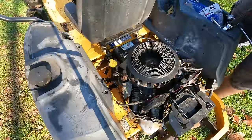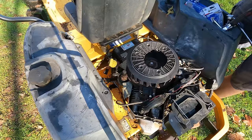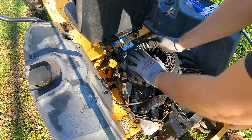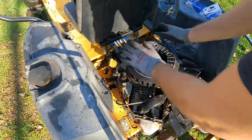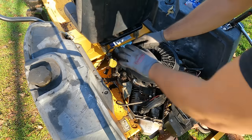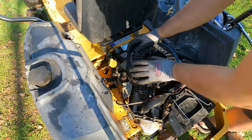Well, this starter is not cutting it, I'll show you. Just seems like it can't overcome the compression. You know, and the compression is not that bad. I gotta look into why. Well, maybe it is pretty tough. 175, does that sound right? I'm gonna take a look at my compression gauge. That's one I got at a garage sale, so.